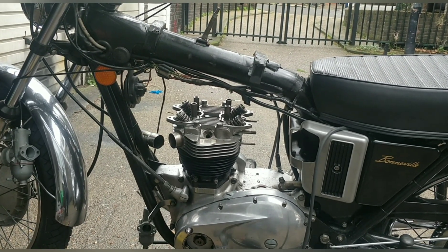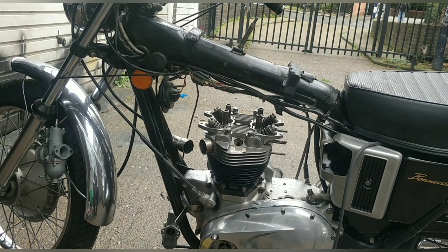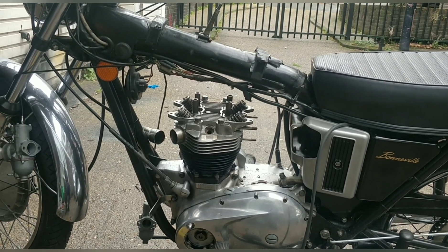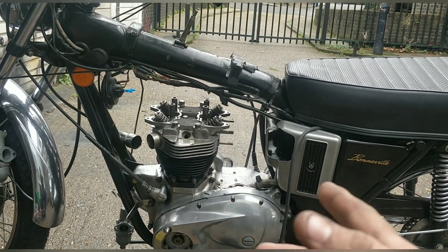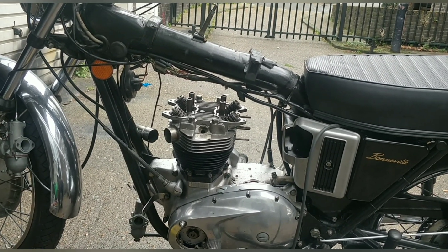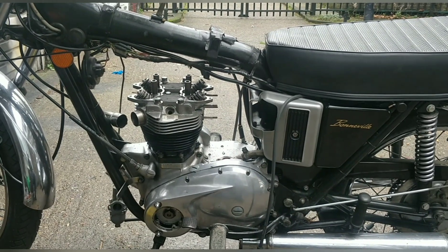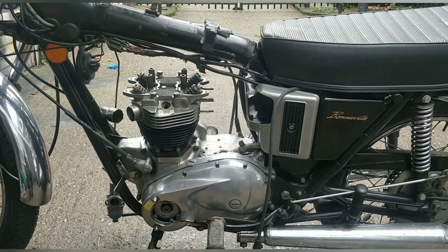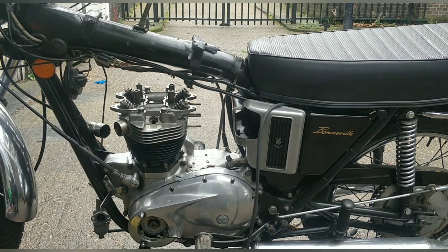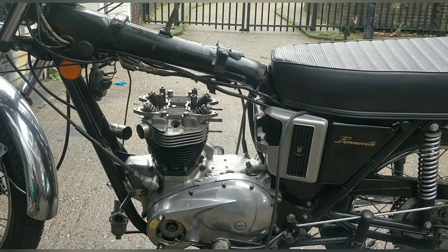The TR6 head is back on - no issues with fitment. Online it says you have to have the exact same year. I don't actually know what year this came off, but I know it's a later engine - 69 to 74 or something - and this is a 73. The head said the same thing, 69 to 74/75, but it said online you have to have the exact year for fitment. I don't think that's right unless I've got extremely lucky and got a 73 head from a 73 bike. We're not out of the woods yet because this isn't up and running.